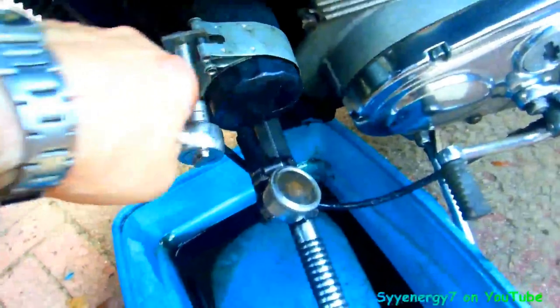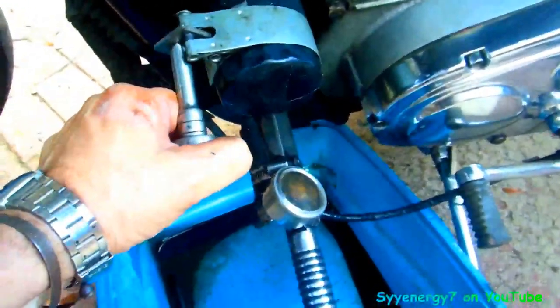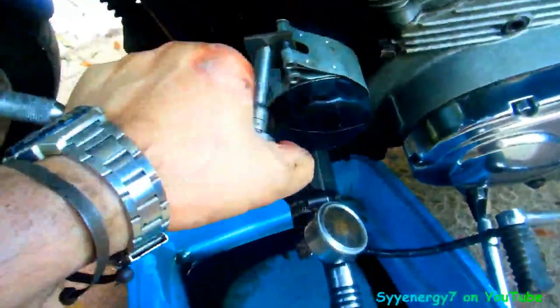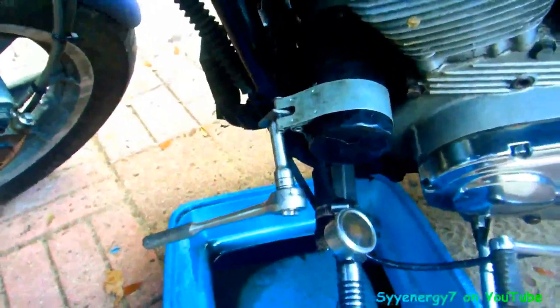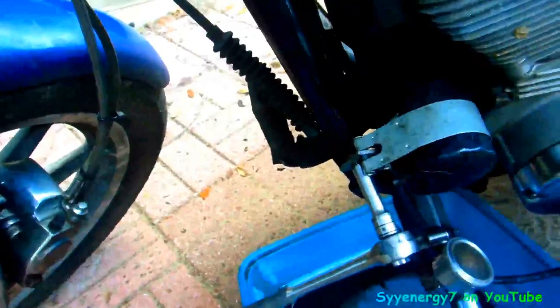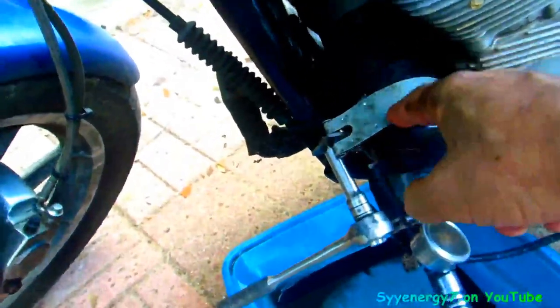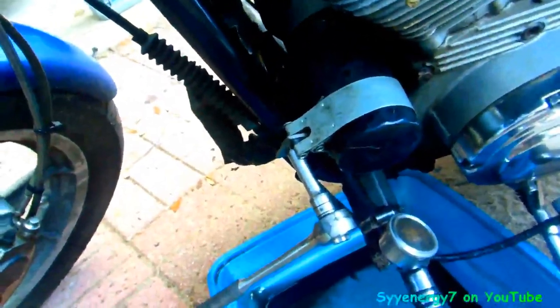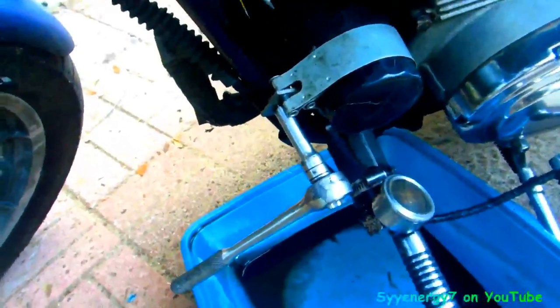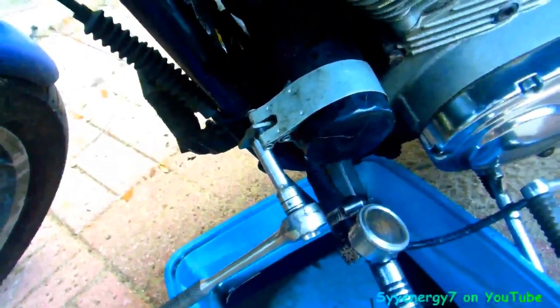I found this old filter wrench I've been using for years. It's a good old filter wrench — it doesn't break. I broke some of the cheap ones. You want to buy a thicker one — see how thick it is? The thin ones bend. That's thick. You can put a ratchet on there with different extensions and get into crazy places if you have to. That's something good to get.